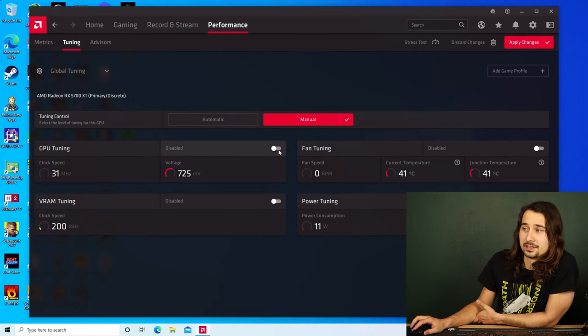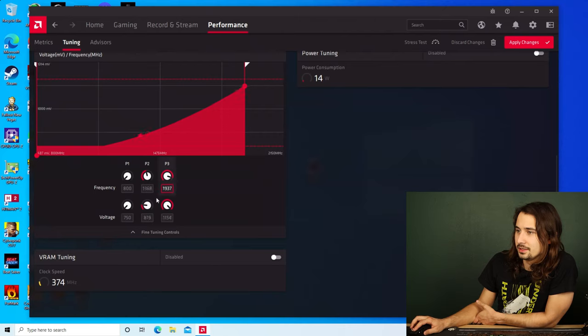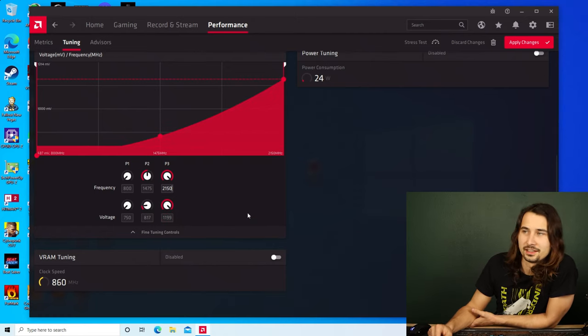So what will the AMD software let us do? You can only get the voltage up to 1,200 millivolts — and it's already maxed out on the voltage side. Honestly, this card can only really benefit from undervolting because it gets so hot. So if you were worried about overclocking your GPU and hurting it during this massive GPU crisis — your GPU is going to die anyway. Overclocking is not going to be the thing that kills it, especially when you're only putting 5% extra voltage through it when the slider says 100% more.